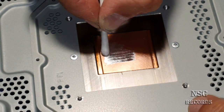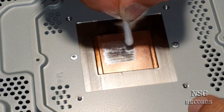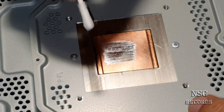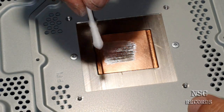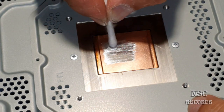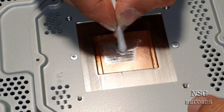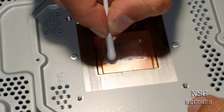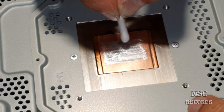And move it like that. See that? Just paint it from left to right. Paint it, because thermal paste from liquid metal is so thin, guys. You normally don't need more. I'm gonna put a little bit more just to be sure, of course, but normally not. The liquid metal thermal paste is so thin, and that's why it gets everywhere between the chip.